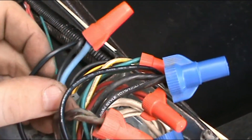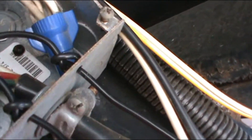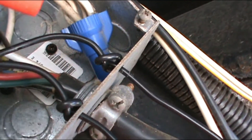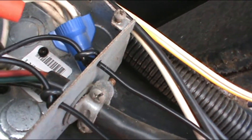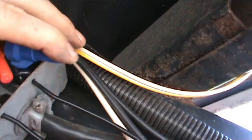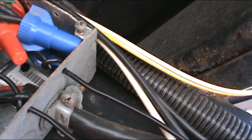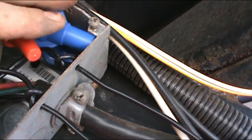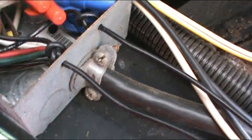If you want to rewind the footage you can — there were only two wires on it before, now there's a third wire. A neat little thing I noticed that they must have done from the factory: they tied little knots in the wires here so you can't pull them back out. I thought that was pretty ingenious. Now if you're doing this with a travel trailer, like my flatbed trailer or any other trailer, instead of coming here to this junction it should go off to a battery somewhere. But seeing as how this battery is fed into this junction box, that's where it's at.